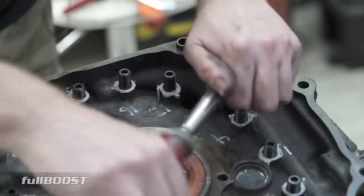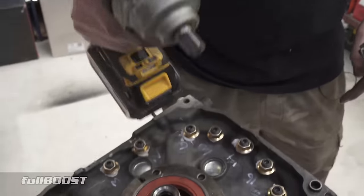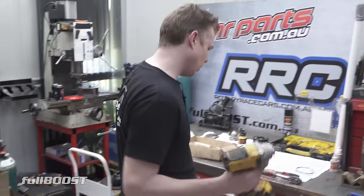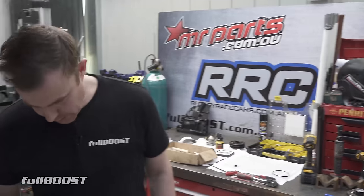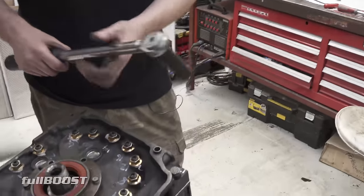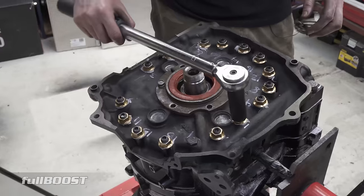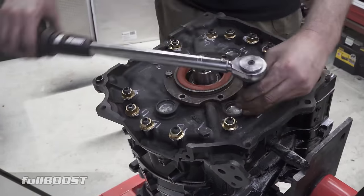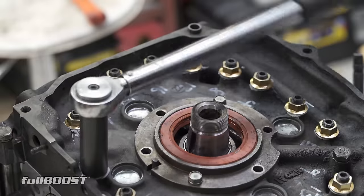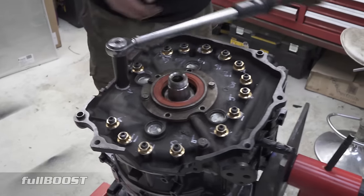Believe it or not, I had this rattle gun set to a finger-tight mode — it'll just click the bolts and studs into essentially finger-tight, then it's right to torque. That's a very, very quick and efficient way of getting all these bolts in place. I'm going to do these in a couple of steps — I'll set this to 40 Nm at first because these half-inch studs take a fair bit more than 40. I'll just sort these out at 40 first and then move around. As you can see they're numbered — we'll just go through that process. Where you find the first couple you do, it really pulls the engine together.